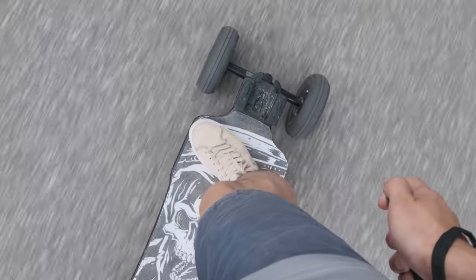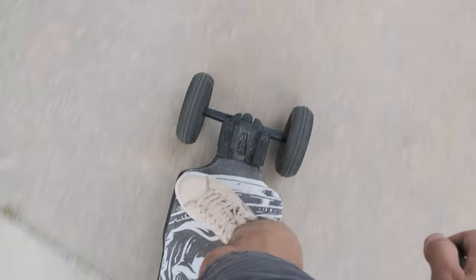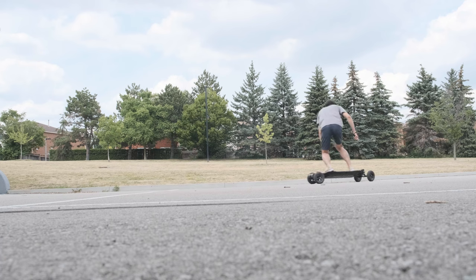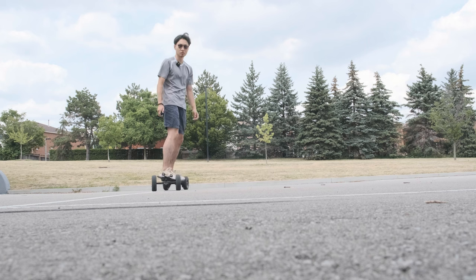I'm getting a little wobble. Off-road — it's very loose for sure. The turning radius is great, I just can't go any faster — that's more of a problem than the limited turning radius. Wow, this thing is really turning. Okay, I'm going to go back and change the bushing — this is too loose, at least for me. I'll change to the harder bushing plus the cup washer.